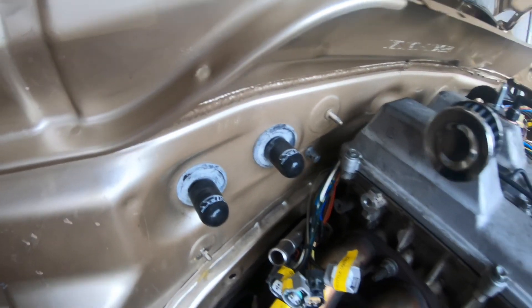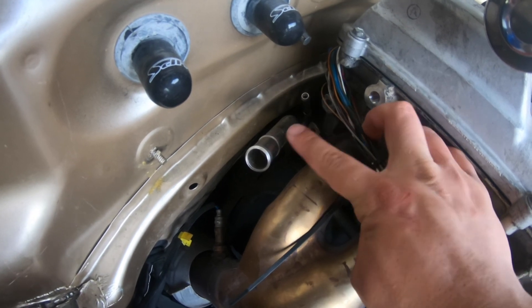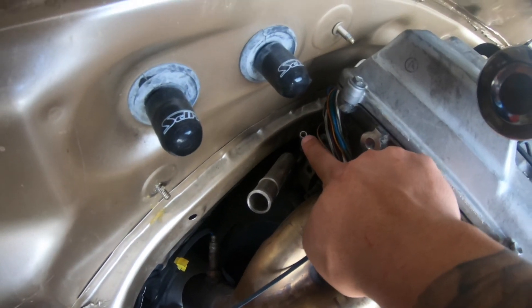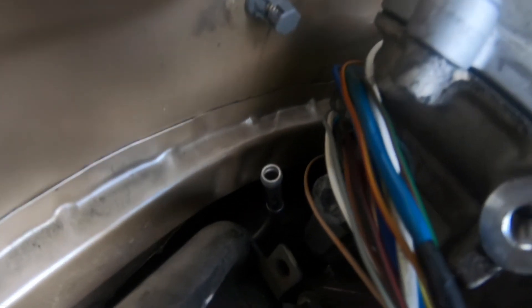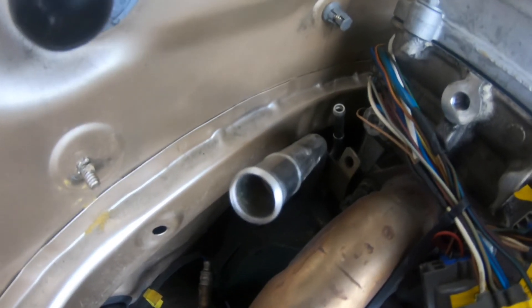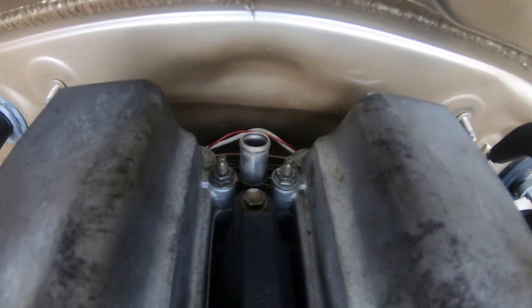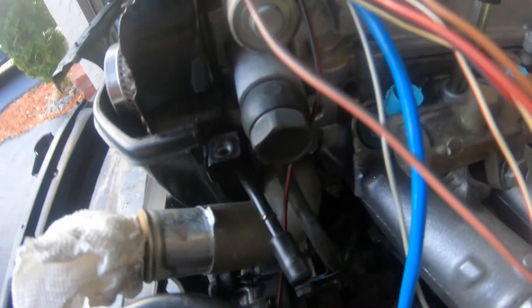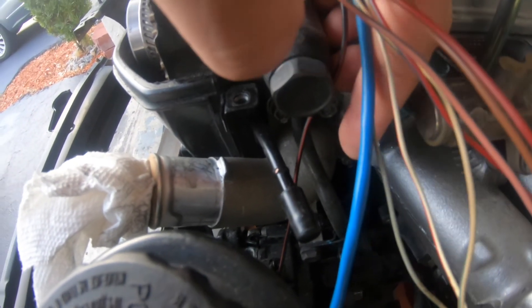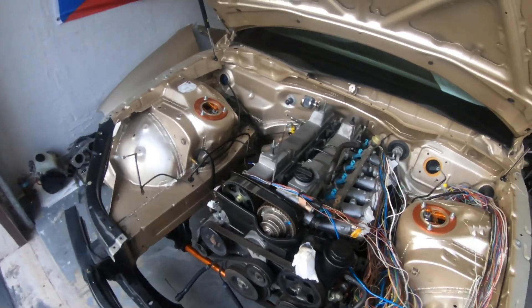The hard pipe that goes to the heater core also has the one that goes to the throttle body — I'm going to be putting a cap on that too. Once I get the actual new hoses for the one that goes up here on the motor, that's how I'm going to route it. On the side where the throttle body cooling hose goes all the way down to the bottom, I'm going to cap that as well. All right, back to the wiring.